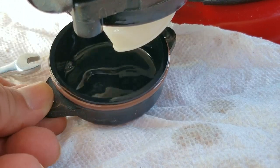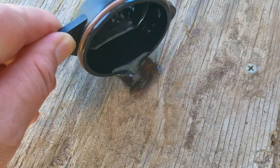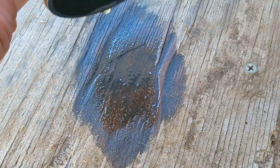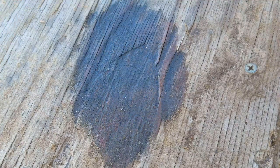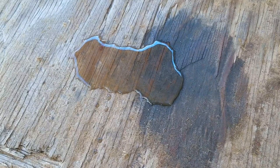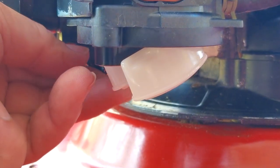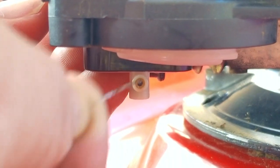Here's the last bit of that old gasoline. It's kind of strange that I didn't see more fuel come out of the carb. I want to show you that this is gasoline and that there's no water in it — to do that, I'll pour it onto this old table and you'll see it soaks right into the wood. If there was any water in it, it would not have soaked into the wood; instead it would just lay on top of it. Now it's not very scientific, but it is a cool trick. The last item I want to tackle is the fuel jet at the bottom of the pickup — all we have to do is make sure it's clear. I'm pretty sure it's not clogged, but I'm still going to make sure it's as clear as it can be.